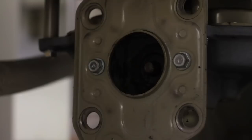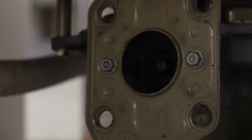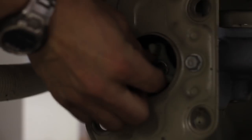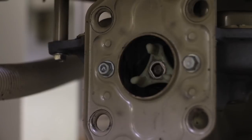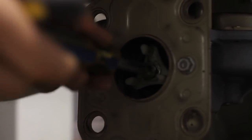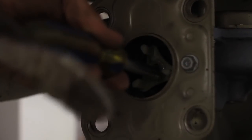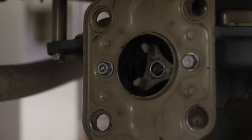Now, this is where we'll see the coupler. You're going to remove the coupler piece from the transmission shaft. You're going to take the new one and line it up on the shaft. Once it gets close, I like to use a three-eighths nut driver because it will seat right on top of there, and then you're just going to hammer it into place. Once that lines up square, you're good to go.